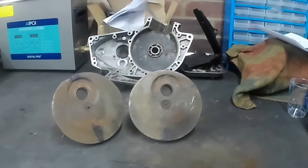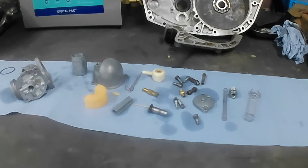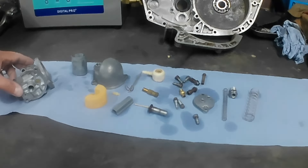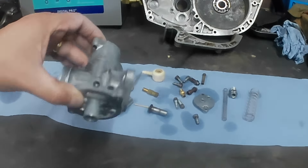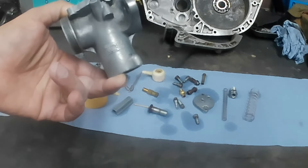Before that, I've got the carburettor stripped down and in pieces and I've been cleaning that as well. The Amal Concentric, laid bare in its constituent parts — just been through the parts washer, given it a going over with a soft brass wire brush which has brought it up reasonably well. It wasn't terrible to be honest — I expected it to be foul inside but it wasn't.